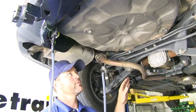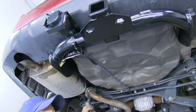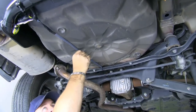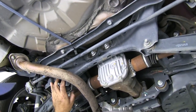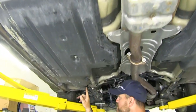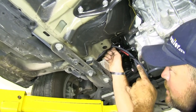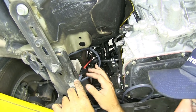Next, we're going to run our wires up to the front of the vehicle. When running wire, you want to stay away from any heat or moving parts. What I did is run along underneath the trunk pan — if you do that, make sure it stays up tight so it doesn't get caught on anything. I zip tied it here, went over top of this bracket, came down behind the heat shield and went underneath this panel, zip tied to this hard line here. From the top on my battery side, I took some airline tube and ran a path through, away from heat and moving parts.